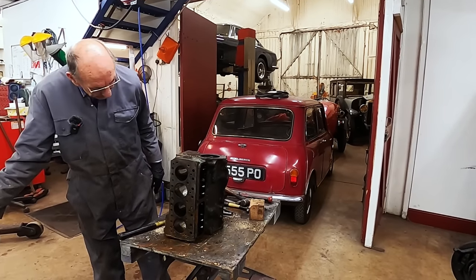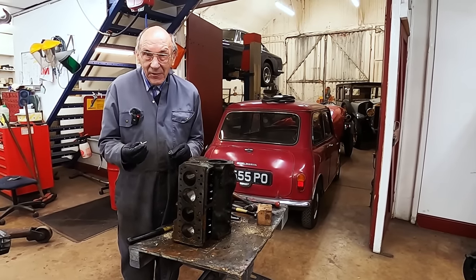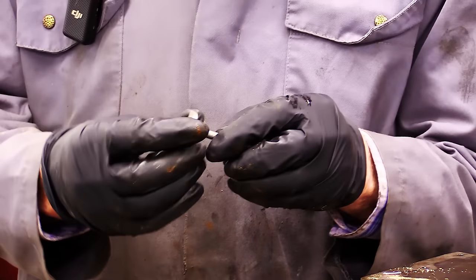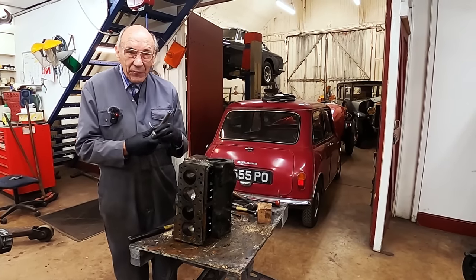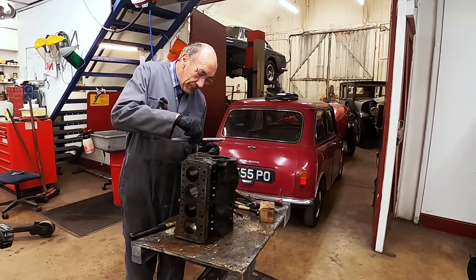find a suitable bolt, which I've found. I'm looking a bit slick here because I've done the other end, but anyway. So get a socket because that's then bigger than that. And then you've got a threaded bolt with a washer. So the next thing is you've got to put a thread in there. So as it happens, quarter UNF is common and I've got a common UNF tap.